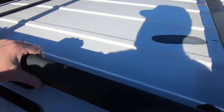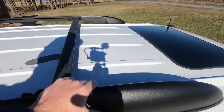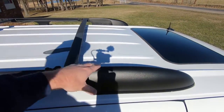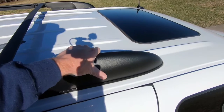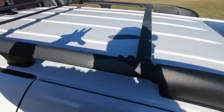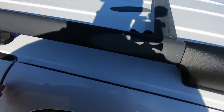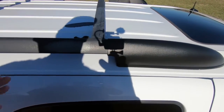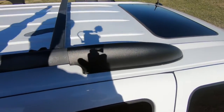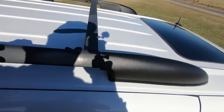I'm going to go grab the Torx bit. I don't know what size it is. I'll let you guys know here in a minute what it is, but the Torx bit to get these covers out of the way. Once we get those out of the way, then we should be able to access the 2 that hold it to the roof. And like I said, later on when we get to that point, we'll show you guys what I'm going to do to plug these holes, but chances are we're going to have some cleanup to do around these areas. I know this thing's set under a tree because every time I wash it, pieces of tree and bark come out of it, so chances are it's going to be pretty dirty. But I'm going to go grab the tool. We're going to get these plastic pieces out of the way, and well, we'll go from there.